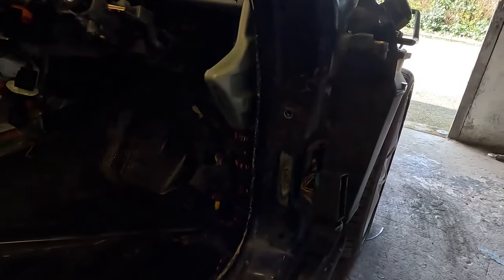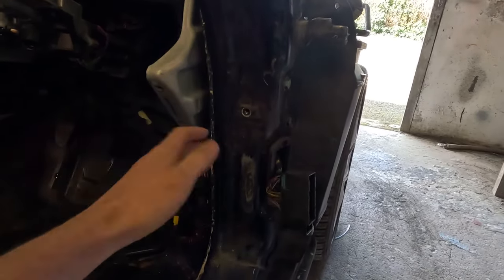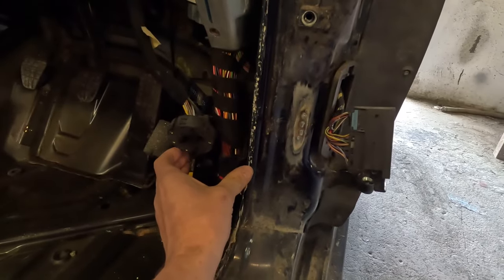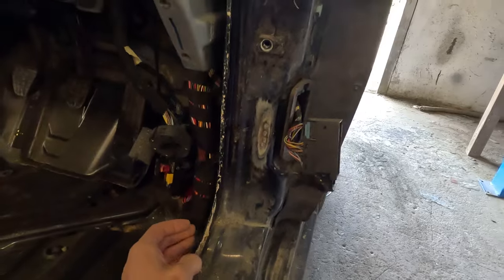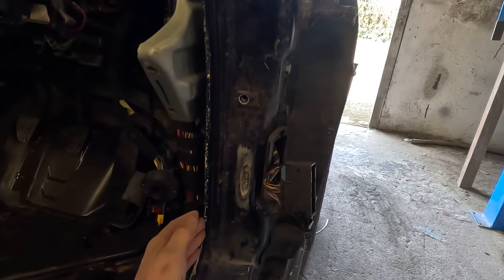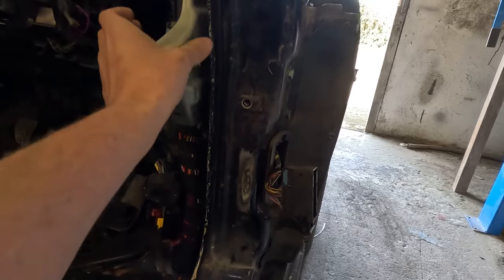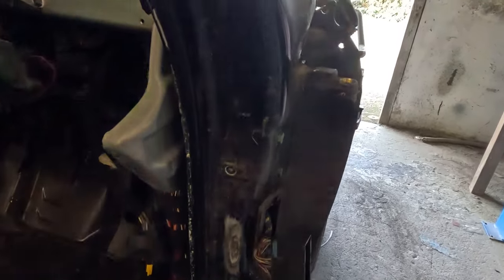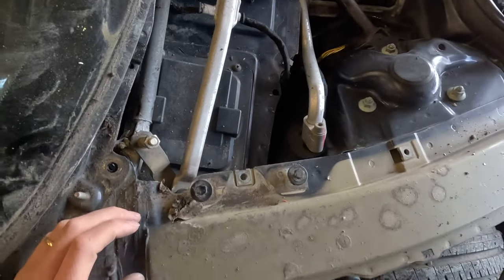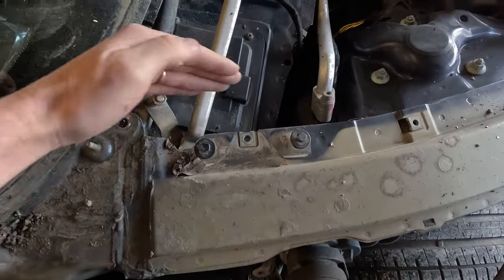I had planned to keep most of this pillar in place and thought the side skirt would probably cover it — just trim a bit of it and work something out for the hinges. But it's actually turned out that the entire Metro would fit inside the Boxster, so what I'm going to do now is cut the entire outer section off. Hopefully there'll be a strip piece in here I can use to mount the door hinges to, and then I'm going to build a folded box section frame to replace the strength on the inside — whatever is cut out will be replaced on the inside. There'll be another piece going from there up to the strut top. This section here is actually 3 inches too far out so it'll have to be cut back, and as I say the strength will be put back in.